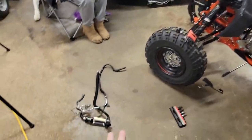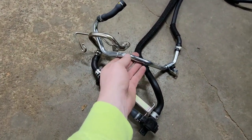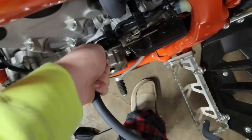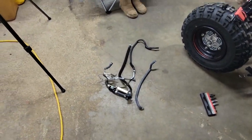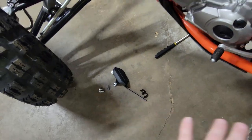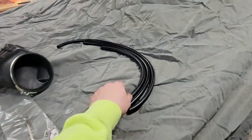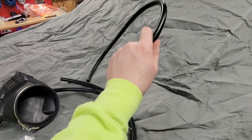If you're not doing the breather box, you will not be removing these hoses and extra lines because they will go onto your existing box on your stock intake. I didn't bolt mine back on because I put fuel customs on and I didn't want this, so I ordered the breather box to delete the factory one and it deletes all this unnecessary plumbing. This tube here is the old breather tube — it goes to the back of the valve cover and to that box on the stock intake. Since we're not using that we take this off. The new breather box will go to here and to here, and then the third hose will just vent to atmosphere underneath.